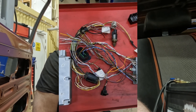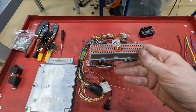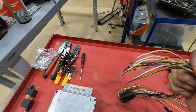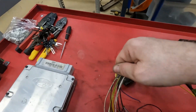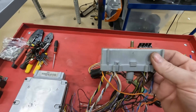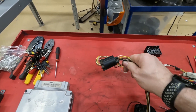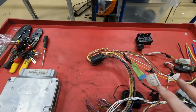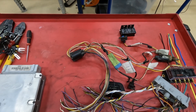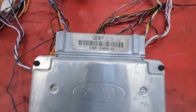A little tip: I took this connector straight off of the escort and I also got the engine loom and chopped that off as well. What I found out since then is that these cables go directly into these cables. So if I'd have taken more time, taken this plug off and followed all the wires back, I would have got to this connector. That would have saved me so much time — I could have just taken off the wires I don't need, sorted the ones I do need, and it's basically plug and play after that. I found that out the hard way.